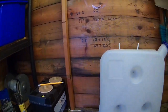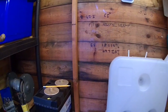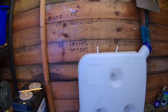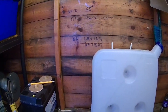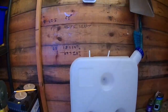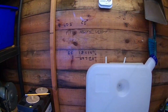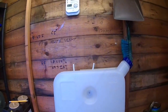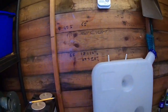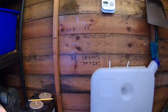Now then, having the fuel pump under the floor has an advantage: it's less sound, unless you've bolted it to a chassis. One thing I have discovered, and it's a very silly one: the fuel pumps are solenoids, and they go dum, dum, dum. There's no motor in it, it's just a solenoid that moves a piston backwards and forwards, so it creates that dum, dum, dum noise.